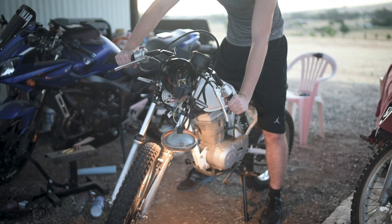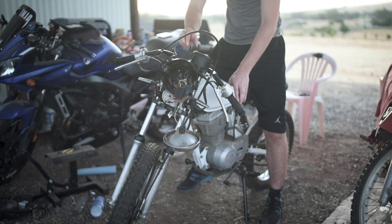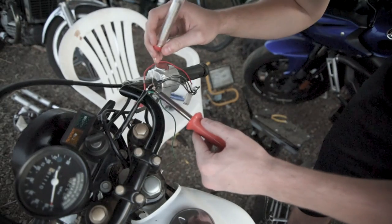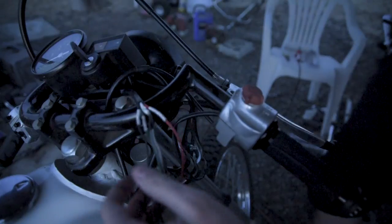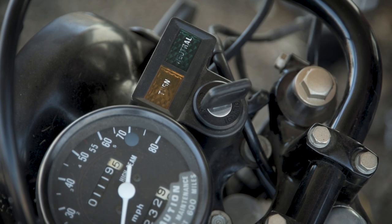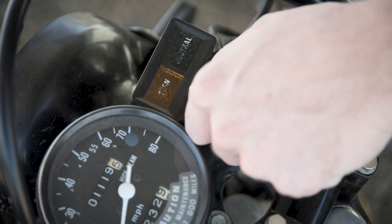It does work — I'm super happy. Let's get this soldered up, the ignition is all good. Let's see if it'll turn off — okay, the switch works. There's a small delay, probably because the wires aren't perfectly connected and soldered yet. Overall I'm very satisfied with this switch — it feels really solid, wiring was super easy. It matched straight up to the Honda wiring: red to red, black-white to black-white, black to black, green to green. Soldered it in, put it back into the headlight assembly, and it was good to go.